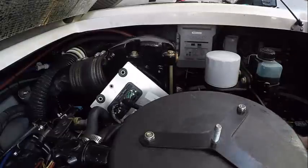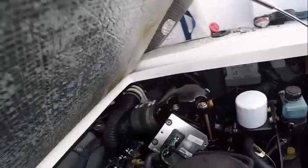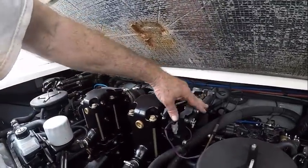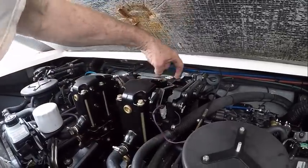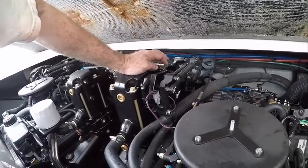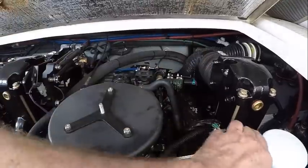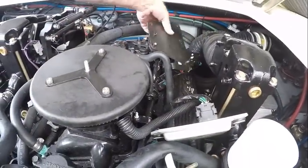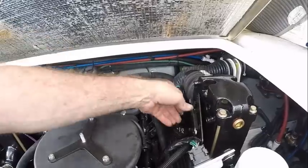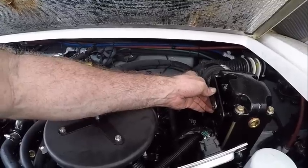Done. Almost. Now on both sides of these manifolds are mounted various accessories. On this side is the whole shift and throttle assembly — it's mounted on a plate using three quarter-inch by 20 standard threaded bolts or screws, depending on how it's set up. On this side is the computer — that's the computer for this engine. Your engine may or may not have a computer depending on what year it is. This plate right here supports the computer and also supports a set of relays in the rear. It bolts three bolts to here, and then the computer itself bolts three bolts to this plate — so the plate goes on first, then the computer.